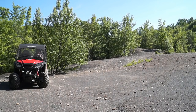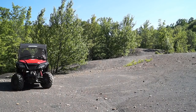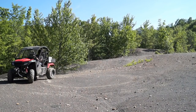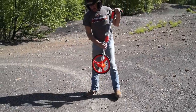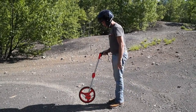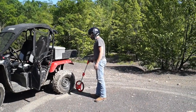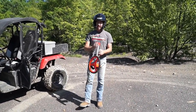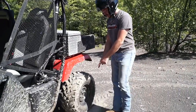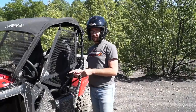Two-wheel drive test — full lock, let's turn. So right here is the inside of our tire in two-wheel drive. We're at a 14 foot 6 inch turning radius in two-wheel drive — and again, this is with inch-and-a-half spacers and 27-inch tires. As you guys can see by the mark we put on, we stopped at the exact same spot we started. We'll use this again for our next test and do the same thing in four-wheel drive with the factory open front differential.